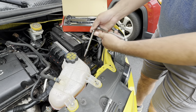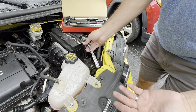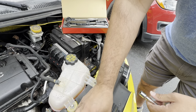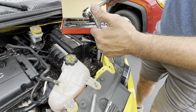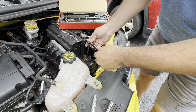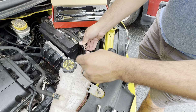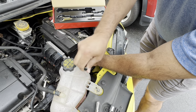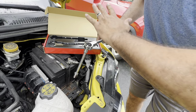There's also the option of adding a longer socket, which would also work and gives a little more room. But again, we're talking about the DIYer who maybe doesn't have the long set of sockets. If you have the swivel head ratchet, you can make it work with just one extension and a small socket. With a regular ratchet you'd be down here banging into everything, but with this you can twist it up and loosen the bolt with no obstacles.